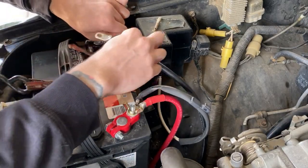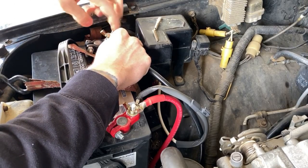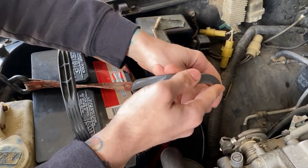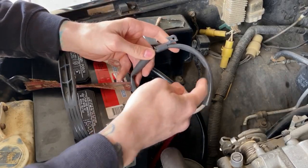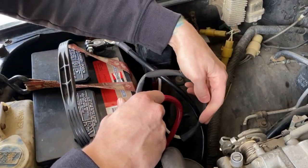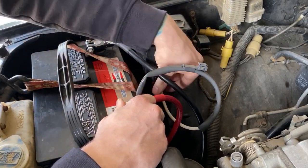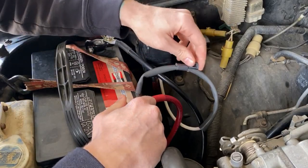I need to get the battery hooked up before I can get this thing out of the garage. One thing to note with these older Toyota pickups: if you're having any weird electrical issues, take a look at your fusible link wire. It's basically a slow-burn fuse, and previous owners have probably had to replace it and spliced it with poor wire and a bad connection. So if you need to just buy a replacement, you probably should — you could also replace it with a solid piece of wire, though a lot of people will tell you not to do that.